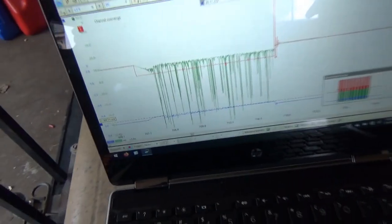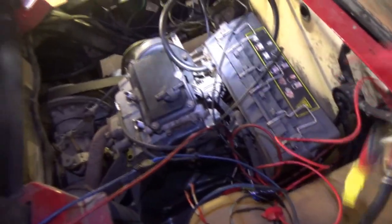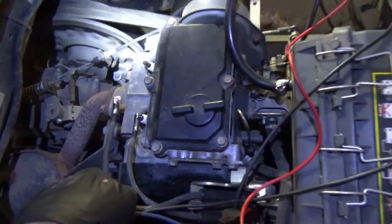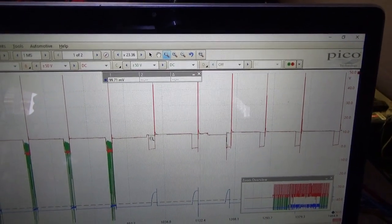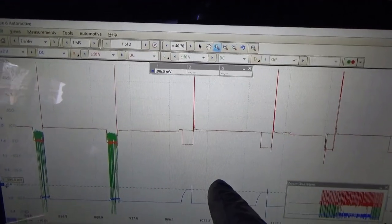Wow — simple golf cart, how hard can it be? Our power feed is dropping out. I'm going to save this with a fused jumper — provide power to that red wire while cranking and see on the scope exactly what happens. Look, it's trying to start — look at that spark! Now let's see the good versus the bad on our scope. When we provided a good power feed, the green channel stays at battery voltage and we get a nice healthy current ramp with the original ignition coil — about four amps.